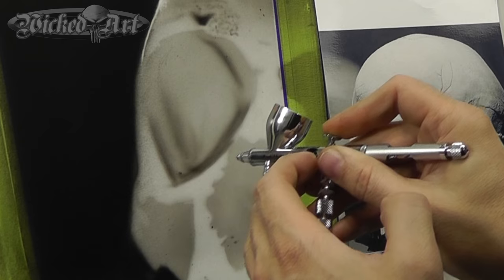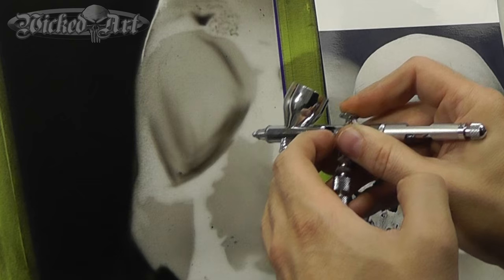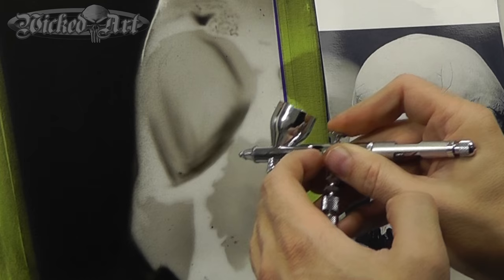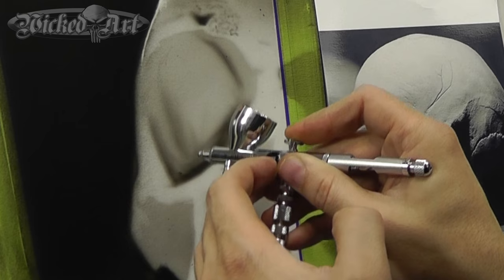One disadvantage I find with the water-based paints is it takes some time to fill in those dark areas because you have to work in light layers. I used urethane for years on all my automotive work, and I had a pretty steep learning curve when I switched to water-based. With the urethane, you can hammer the paint on with no issues, but the water-based stuff doesn't react well to that, so it requires some patience. So we will skip ahead just a little bit.